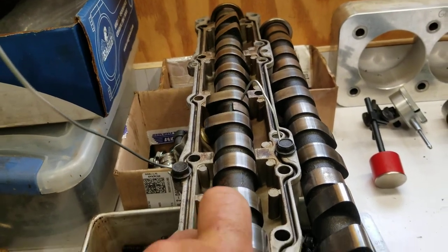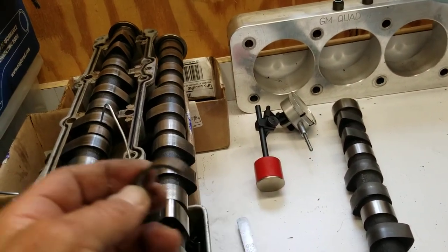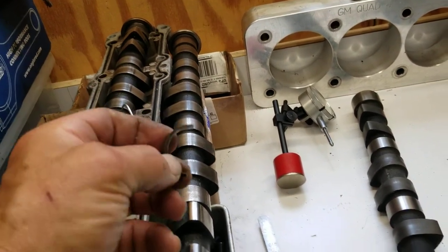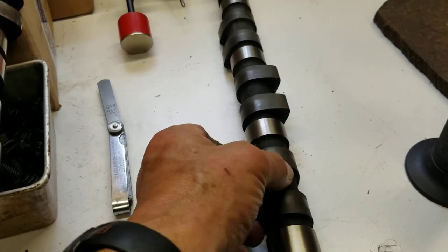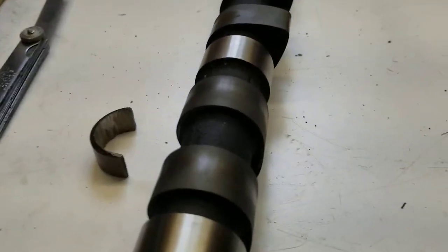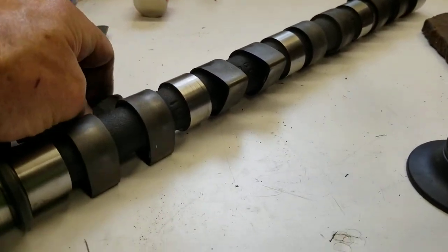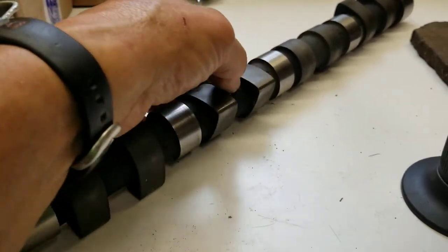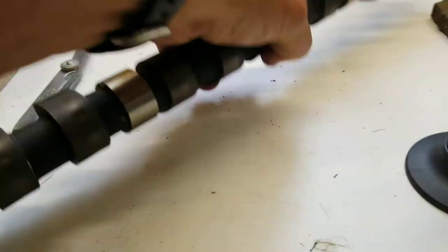In relationship to the cam - what we're trying to do is we rubbed this off of the 2.4 cam, cut the piece out, and ground out the center so that it'll lay on a 2.3 cam and we can use it for a cam position sensor. This is our 2.3 cam and this is our sensor pad. We used the degree wheel to set the position and we have it marked - that's on the other side actually.